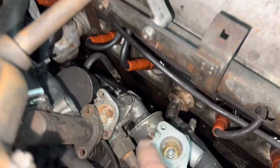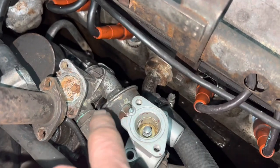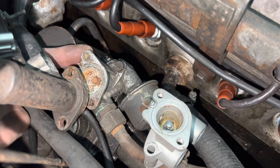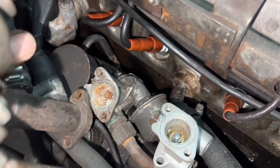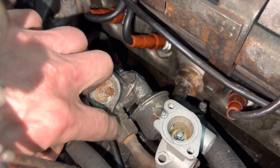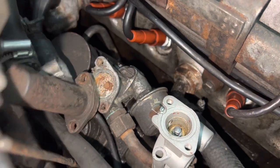You can see there should be a little adjuster screw here which basically locks this bolt in. On our car that's snapped off and that piston isn't moving up and down at all. Now it just remains to be seen if we can get these two bolts undone.